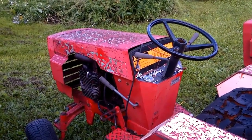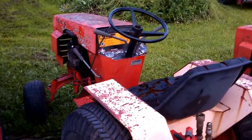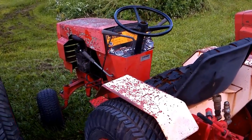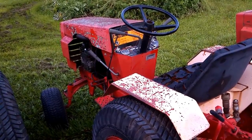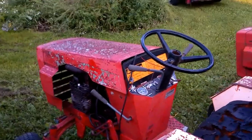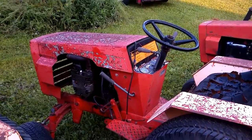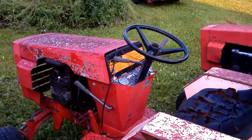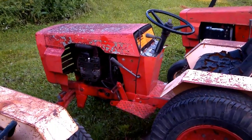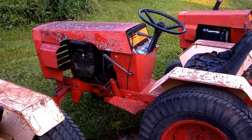That one needs a muffler. I had to put in new points, condenser, and plugs. It was actually seized when I got it home, and I hauled it to a close friend, Norm, who helped me unseize it. I got it home, picked up the spark plugs and points, and lo and behold I got it running. I'm going to put it back together and work it to see how good this engine is — the cylinder was pitted pretty bad, and I don't know how it's going to hold up once it gets to working temperature.